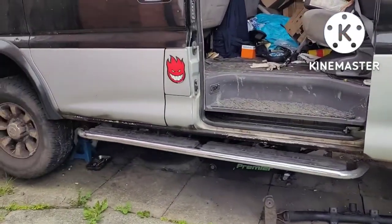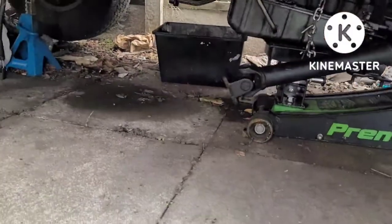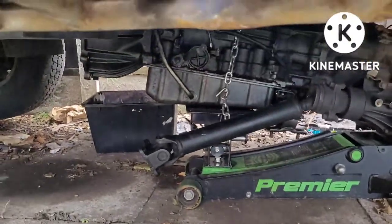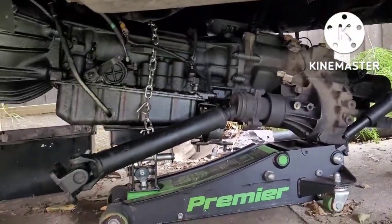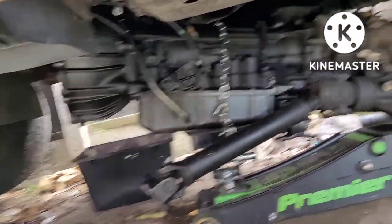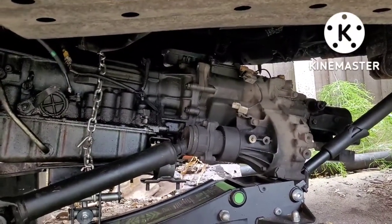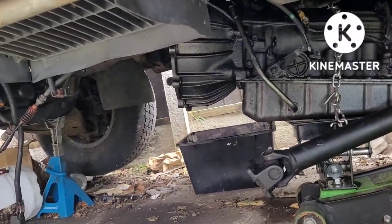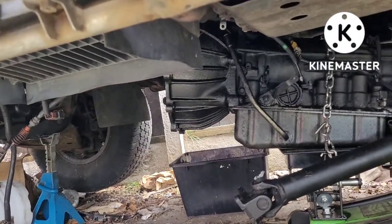Back on the Delica — Project Delica, the rear main seal. It's been a while since I've been on it, got busy again. My little trolley jack with the adaptation seems to be doing this job — it's held up even with that not-exactly-small gearbox on there. Got it up, got it down. We're going to be taking the rear main seal off. I'll get the flywheel off first, then the rear main seal out. Once you get the back together, it's just rebuilding in reverse. Let's get started.